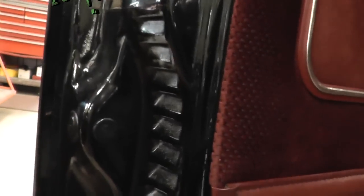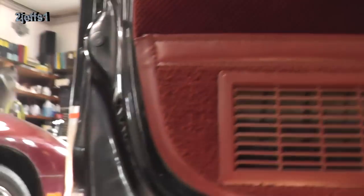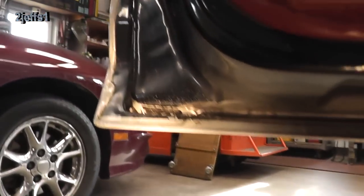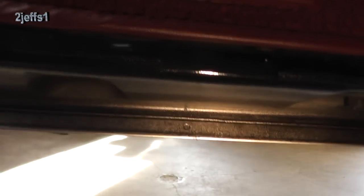To be clear — this is the plug I take out on the door, and then I use that real long 360-degree sprayer tube on the end. I just pull this through the door while holding the trigger on the gun. Make sure your window is up at the time. The neat thing is it preserves your window mechanisms and door latches so everything works great years later. If you don't feel like taking your door panel off, you can cheat by going through the water drain holes already provided on every door. Insert the tip of your undercoating gun up through there and give it a squirt — the oil will sit in the ridge all along where the door skin wraps from outside to inside. That's where they start to rust otherwise.